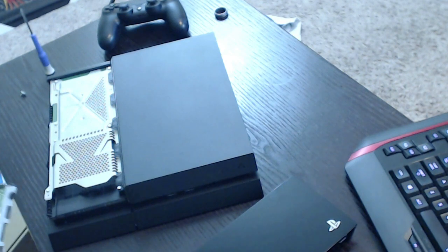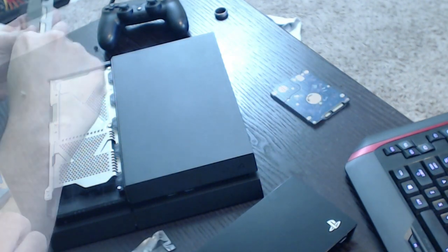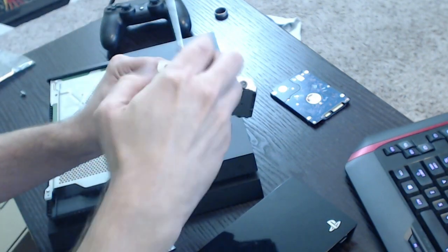This process is actually quite a pain on the Xbox One — it is doable, but you have to take the whole system apart. The next thing is there will be four screws attaching the previous hard drive to the metal housing, so you want to take those four screws out. They all come out pretty easy. After that, you want to put in your new hard drive the same way the old one was in.